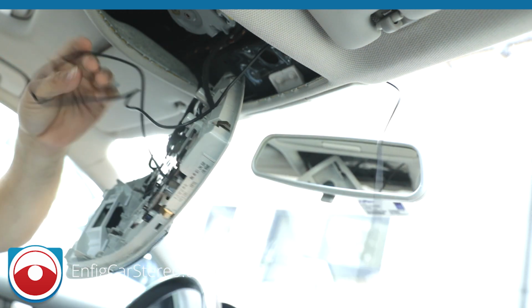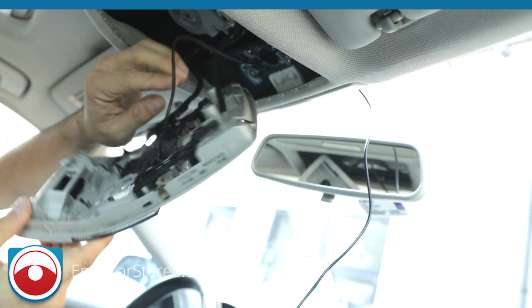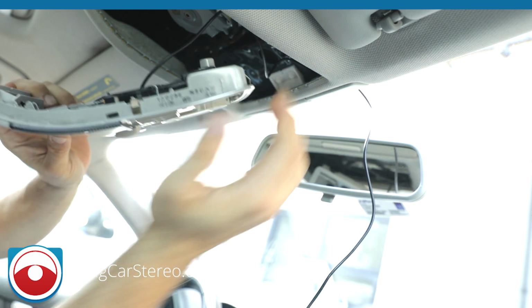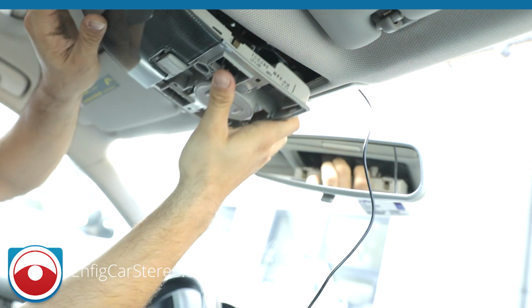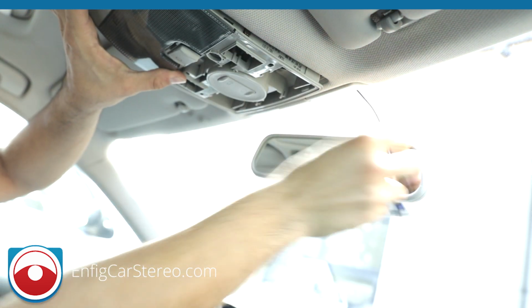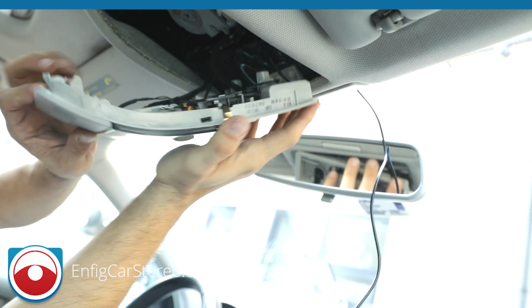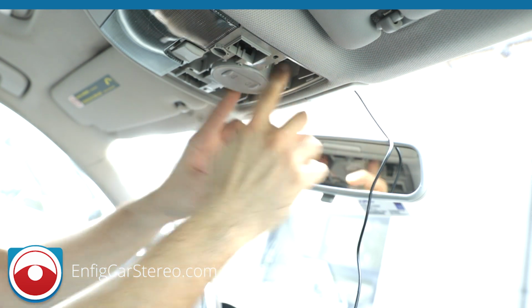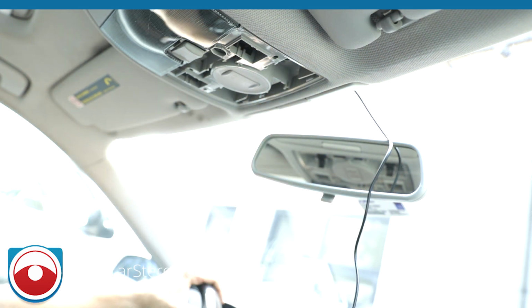All right, so very important. When you do this, make sure that the wire lands between these two, and look in the hole before you put the screw back on, because I myself have gotten the screw gone through the wire. Okay, so that goes there, that goes there. Put the 2 screws back on, and we'll continue on the other side.